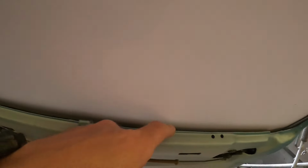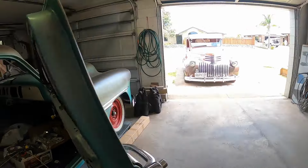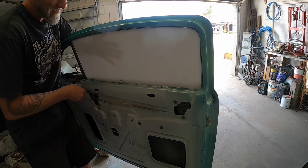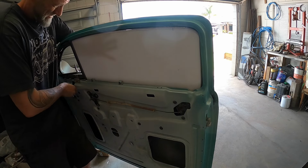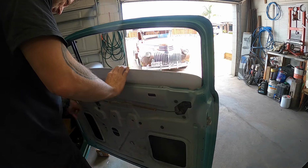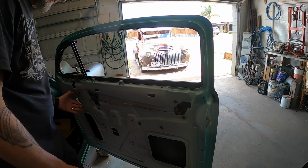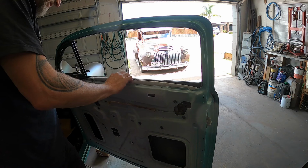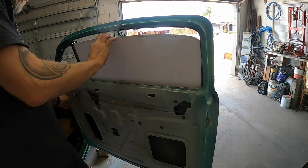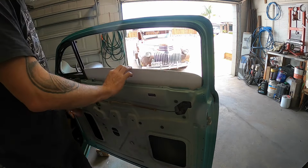Okay, so I've got it back in, and in the track now down here, as hopefully you can see, and that's still leaving that excess in there. So final step, I guess, is to wind it all the way down and make sure it goes down far enough now. Try and keep it in the track. I could actually even have left the glass longer, because it drops right down below the level. Unless I extend the stopper at the bottom, which I could do. Yeah, man, that's us.